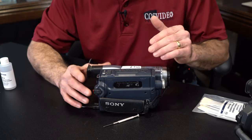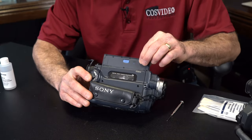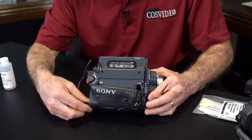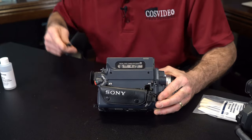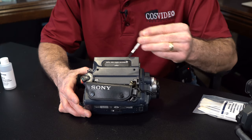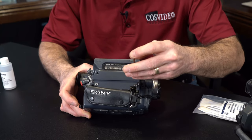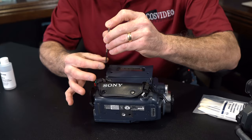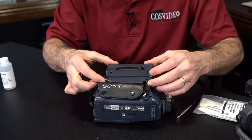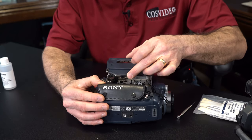In order to clean the heads and really get down in there, you're going to have to take off this faceplate. First I'm going to eject and get it opened up, and then most importantly, unplug it and make sure that there's not a battery in there as well. We have two screws — one right here and one right there — that's it to be able to get at this and see what's going on inside. There's the second one. The strap isn't interfering with anything, and this should just pull right off.